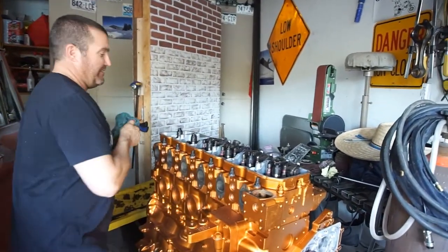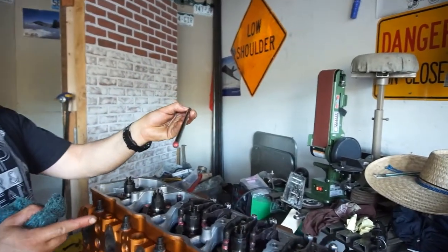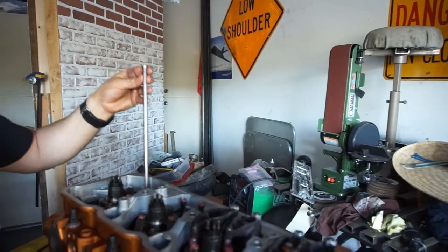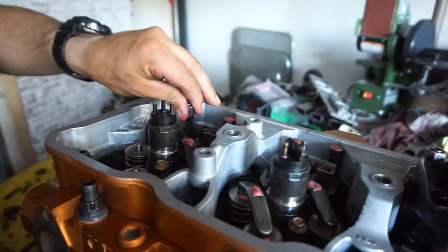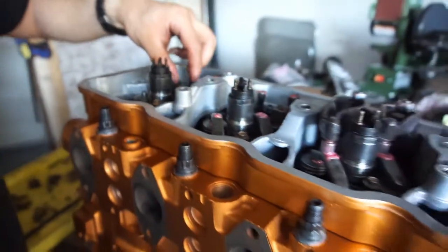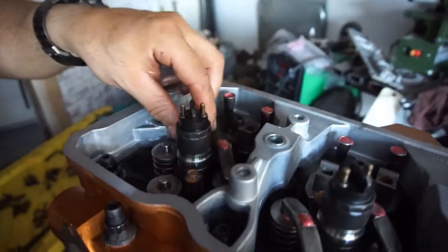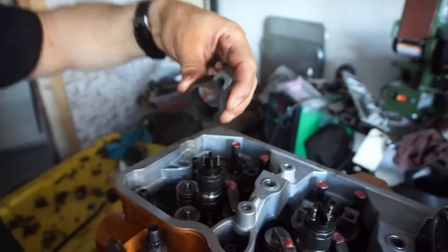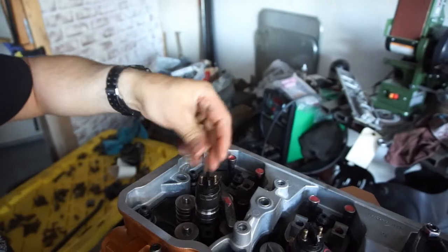So basically, you got the push rods. I cleaned them all up, put some assembly lube on the ends, on the ball, and drop them down in there, and you can feel the tappet coming up and down. And you have these little rocker towers, I guess you can call them. Then you have these injector stays, hold downs, so tapered goes down, and it's these two bolts.